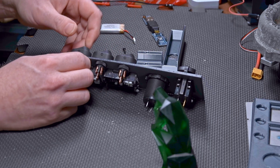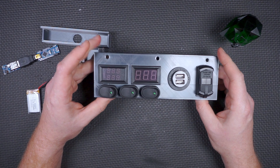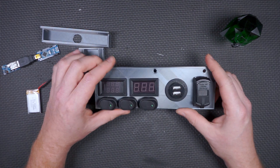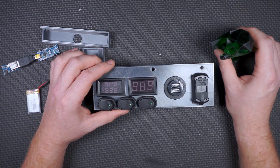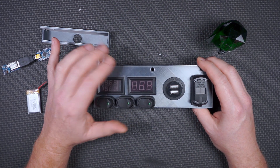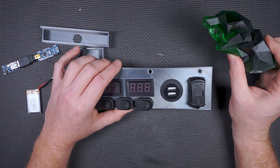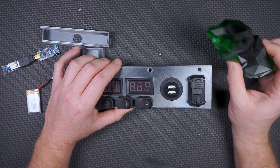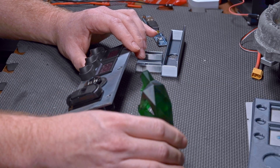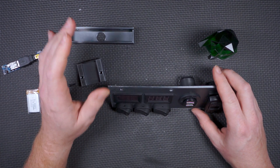It's worth noting that most of the interior of most cars is made out of ABS, and that's another plastic you can print with, although I have zero experience with it. PETG is probably the best bet. Now if you want extreme high temperature, that's when you go to this. There's a guy in Hungary who actually tested this — the PETG was good to 75 degrees Celsius, the PLA was good to 58 degrees Celsius, but he stopped his test at 200 degrees Celsius and this other material didn't even get soft. So you can always print out of that — it can be pretty much any color. Most likely I will use PETG for this, since my SLA printer isn't big enough to print this in one piece.